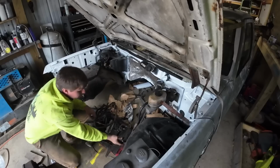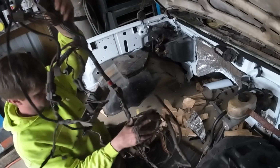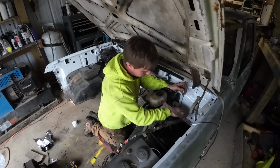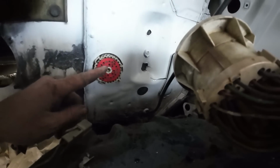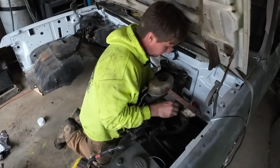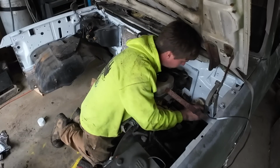It was the speedometer cable that was in the way, but we got that routed. I want to try to tackle this mess. I would like to start anyway, at least get this connection back here. All right, I need to get that other end shoved through first. So we got that pushed through, and then this plugs into it, and see that bolt right there? That bolt threads into the center and then holds it all together, sandwiched. And then this has little keyways, essentially. Now, in theory, a fella shouldn't be able to get it wrong. And I can actually reach in through this column hole.